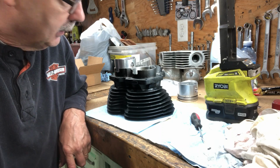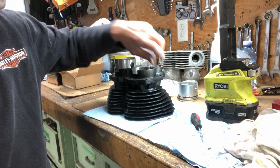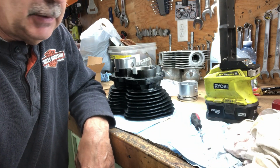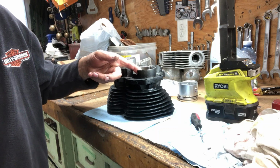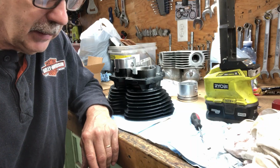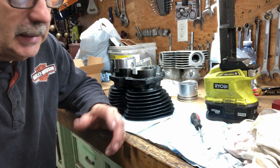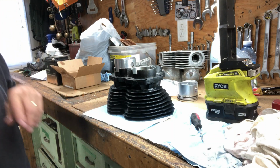Back on the Norton. Fitting these piston rings in. I got a new set of piston rings. And I didn't like those oil rings where the red and green had the butt. They couldn't overlap. And they were too big. Just putting in the oil ring expander, the centerpiece, it was too big to fit in the cylinder. It was buckling. I think somebody hodgepodged together that whole ring set there. There was no chrome top ring. There were four second rings, and then that oversized oil ring. So I just bought a new set of rings and am going that route.